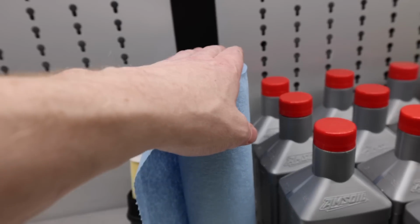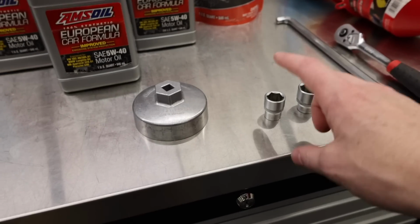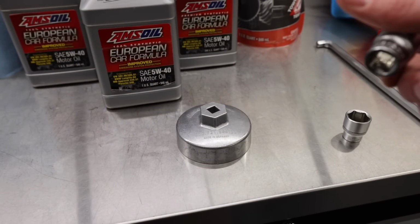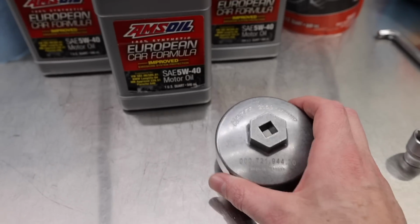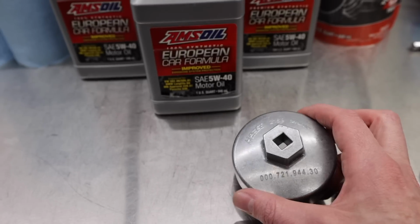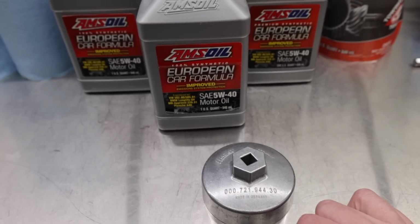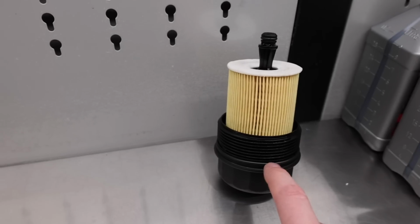Need some towels. I obviously needed a ratchet, and you need a 19 and a 16 millimeter, and then, is it 15? 19 and 15 millimeter. I need the Hazet part number 000-721-944-30. This fits pretty much all oil filter housings on all of the GT3s, at least all the ones that I've owned. And then I need a new oil filter. I'll put the link in the description. You need a new O-ring that comes with the oil filter kit that you get from Suncoast.